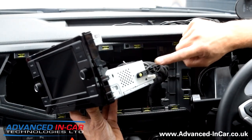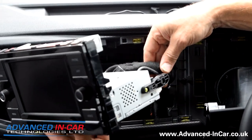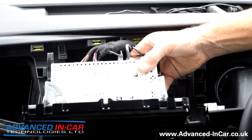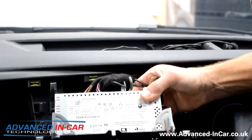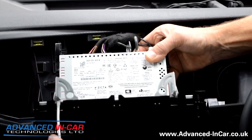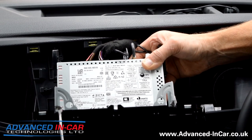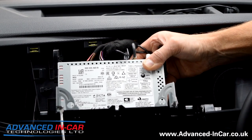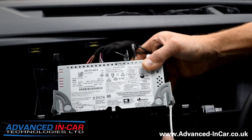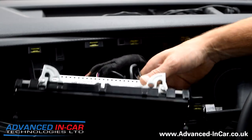These are your locating lugs - you've got to be careful here. You can put your hand down and just pick up the rest of the cable. If I tip it up, Tim will be able to show you the reason why you just use a simple screwdriver. You can use a radio release key, but the screwdriver goes in and just bends the clip. All you're doing is using the screwdriver to release the clips on all four corners, and then the radio will come out.